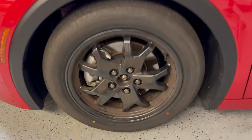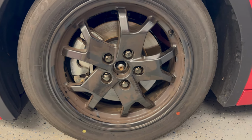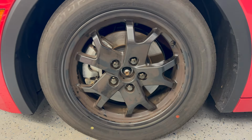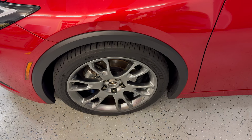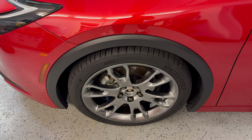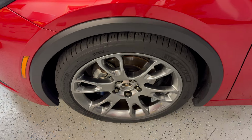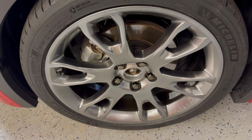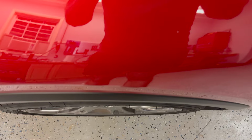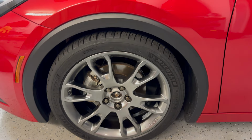The 17-inch wheels look pretty fascinating with the plastic aero hubcaps removed, and as you can see, they packaged them very tightly to these 11-inch brakes in here. The original Prius wheel was a 17 by 6.5, and this is a 19 by 7.5, so we have added a little bit of width, but there is only 1 millimeter of difference in the offset, so it fits quite nicely inside the fender well, and the gap is really perfect with these springs.